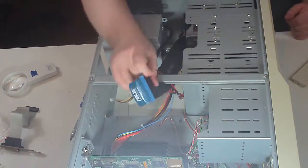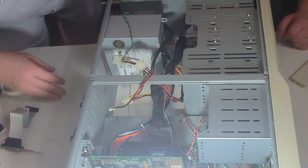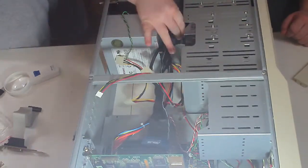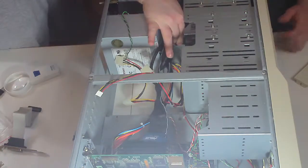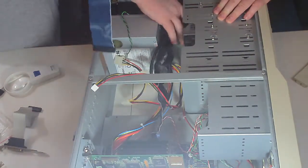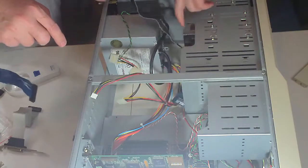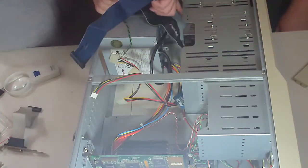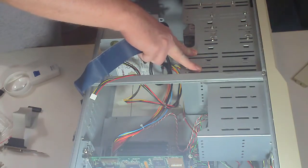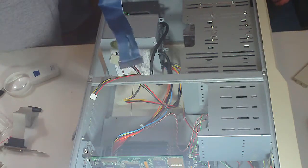Now I'm not entirely sure this data cable's gonna reach, Dad. That is a problem. Am I gonna have to rearrange the order that these drives are in? I may have a longer cable and I can go look for that, but think about this in terms of floppy, and you can see there's only one flaw with it. The wrong kind of floppy? Nope. It only has one head, so you can only use one floppy right now. So this is the 5 1/4 drive. This doesn't plug into both the floppy and the... That's not a floppy, that's a hard drive, and that's the CD-ROM. And those, I guess, need to move down here. Yeah, we need to rearrange. Let me see if I've got a longer cable for IDE. But in the meantime, this is a floppy, and you'll have to figure out how.